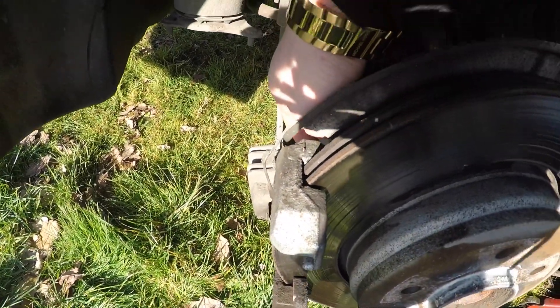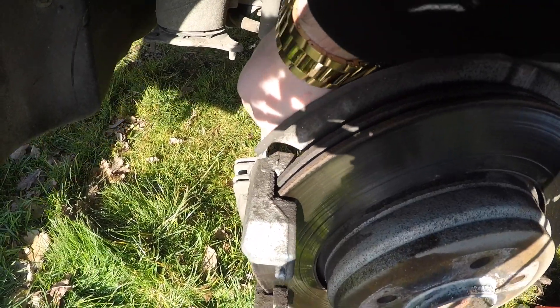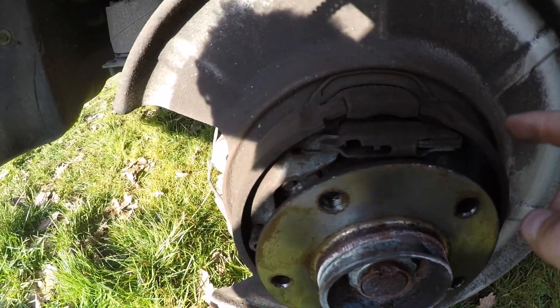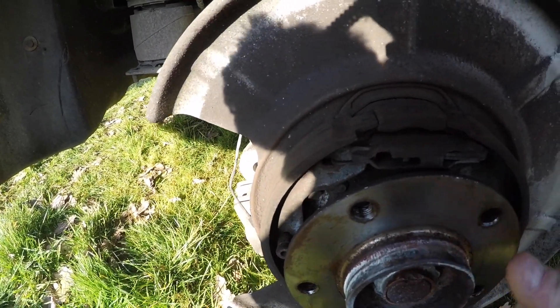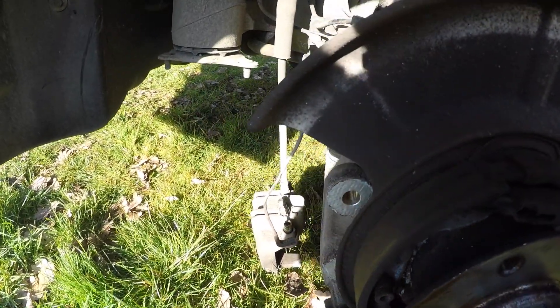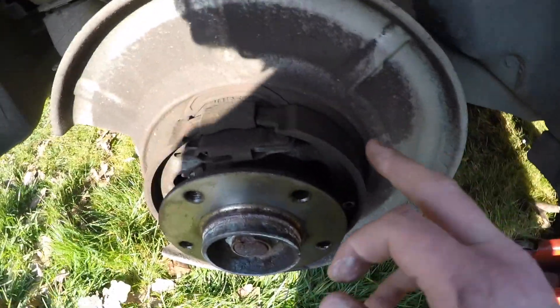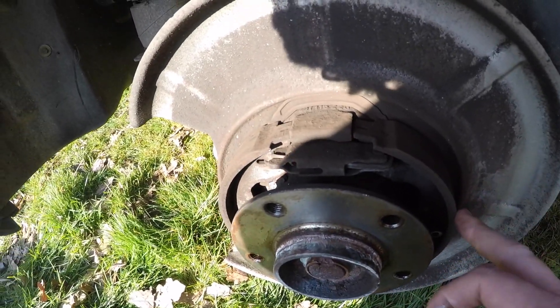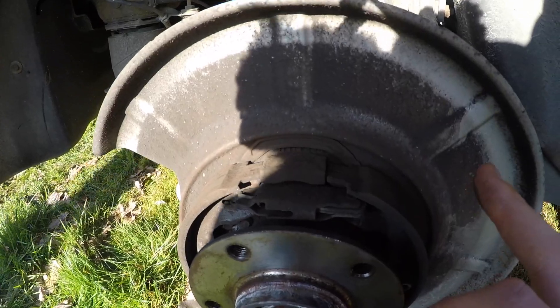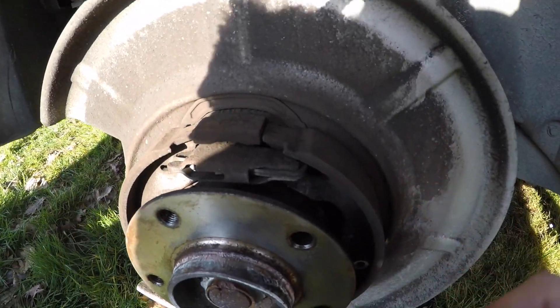The carrier bolts are actually 18mm, not 17mm — just for future reference. As you can see here are the brake shoes. Now what we're really going to do is put the new disc on and then readjust the brake shoes, because my handbrake is not sitting properly — it's doing more than four clicks. I need this done for MOT, so it needs to be readjusted properly to the correct level, otherwise it will fail on the maximum efficiency threshold.